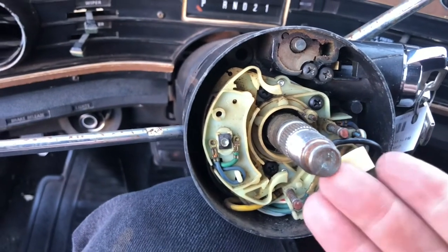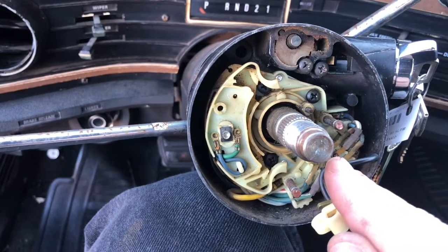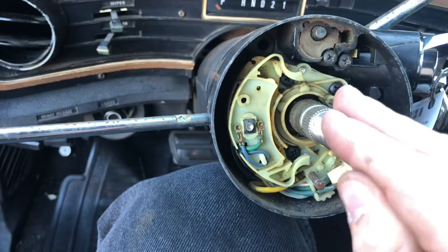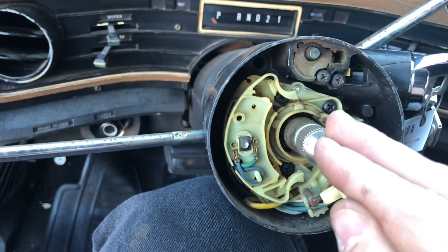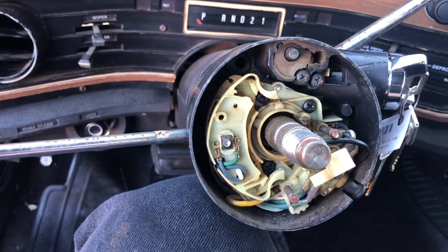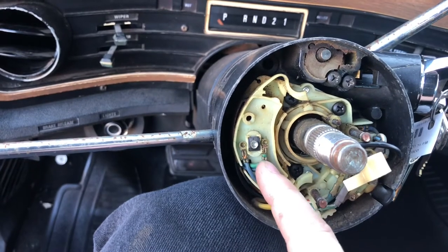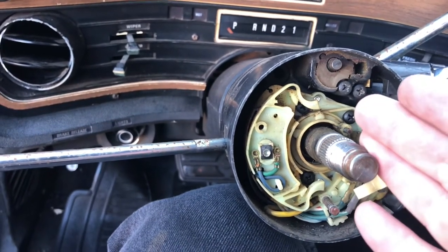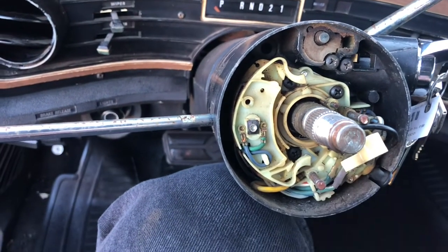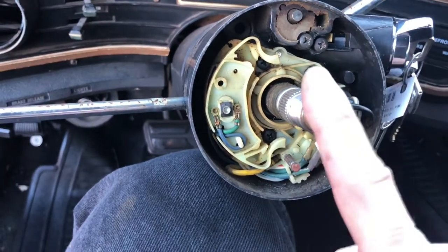Here's how you fix it. First and foremost, take your steering wheel off. Use a steering wheel puller. Don't give yourself hundreds of dollars of issues because you wanted to skip getting a steering wheel puller — they're like 20 bucks. It is not worth breaking your steering column or your turn signals just to avoid a tool you might use again in the future. You can even rent one at AutoZone for 20 bucks and get your money back right then and there. So use a steering wheel puller.